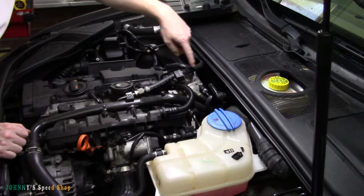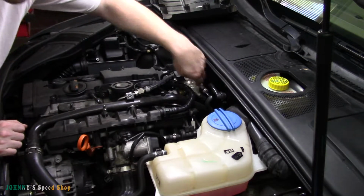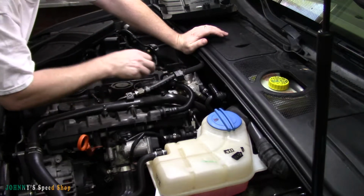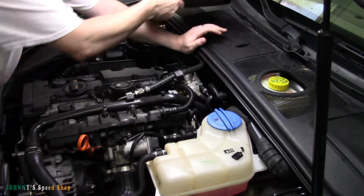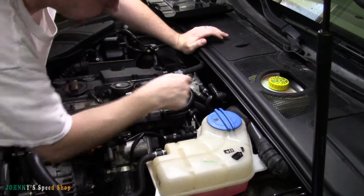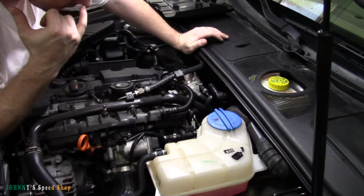And then the high pressure fuel pump is right here. It's held on with 3 Torx. They look like about a T27 or a T30, not sure. We'll figure it out. I might pull this little bracket out of the way too, it's for the cover that sits on it. And then a couple of electrical connectors. And then there's a hard line on the underneath, way down in here, which I'll see if I can get you guys a shot.